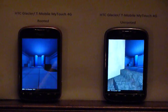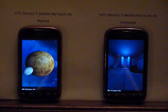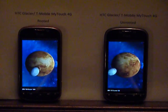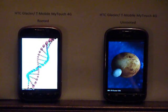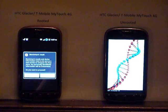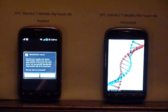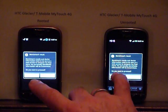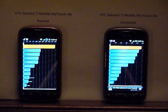The reason to root this phone for me has a lot to do with being able to do things to extend the battery life, aside from being able to turn it up to 1.7 GHz which is good to smooth it out and make it run faster. It also allows you to underclock it to 245 MHz so you can save battery. You can set up profiles to do that.